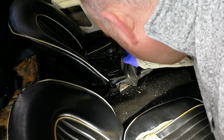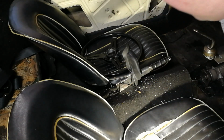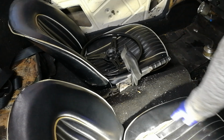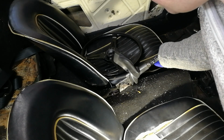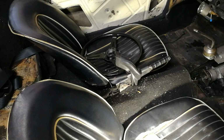I've finished the handbrake. Unfortunately, in the process, despite putting it in a proper tray, the circlip escaped. So here's a handy tip for when you're restoring a vehicle during lockdown when you can't get to a shop. The old rear brake cylinder clips are also the exact right size for a 1/2 inch circlip. So I put that on there, bent it around a little bit so it stays put, and that's doing the job and holding the brake lever relatively tight. Could be a bit tighter, but the proper circlip should do that job.